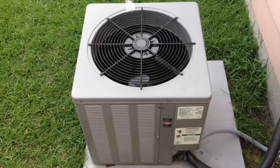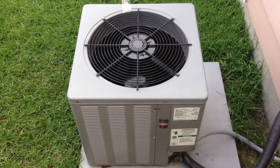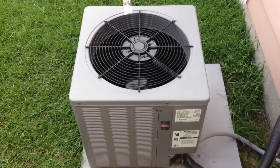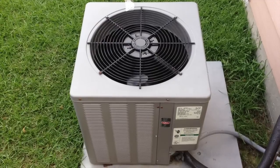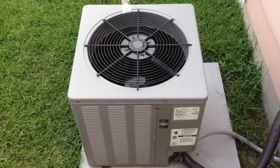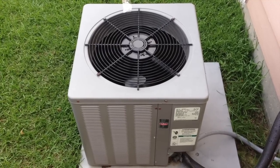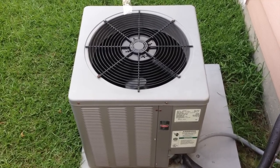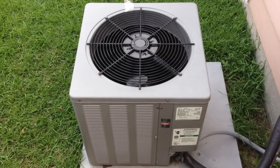Today I'll be finishing the repair of this Weather King air conditioner. First thing I want to do is get the fan grill back off the top. I've already gotten the screws loose and removed the motor. There's a bad capacitor — or more accurately, an improperly specced capacitor. We're going to take this grill off the top and get to where the motor goes. The old motor is already out, but through seeing how the new motor mounts, you'll see how the old motor came out.